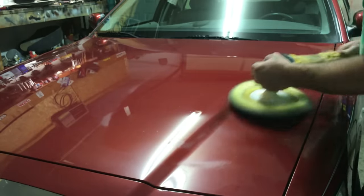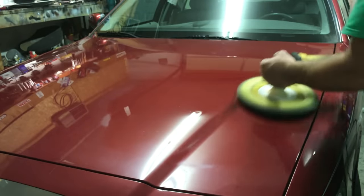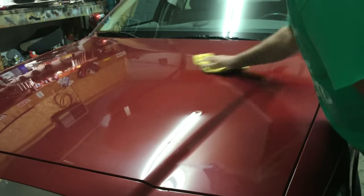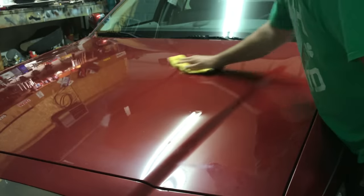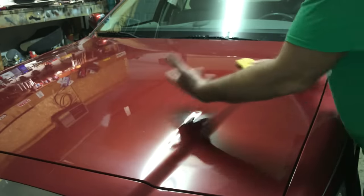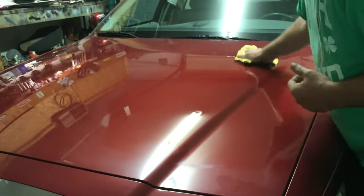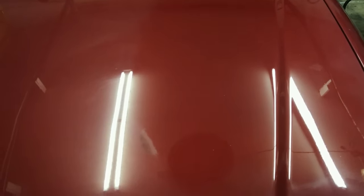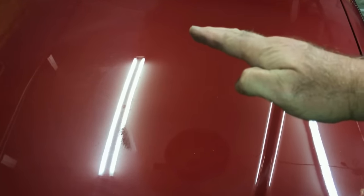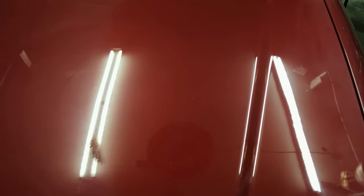Now hold it flat, then take your microfiber — you'll get no scratches, crazing, or anything when you're doing it this way. If it was ceramic coated, after you do this don't use any wax — use a polishing compound and then 99% rubbing alcohol. That's all it is, folks. I don't like doing videos this long but I wanted to show you how to use it: tip the buffer on an angle when it starts to dry up, put a mist of water on it if you have to, and use a super high quality 3M polishing pad. You'll be good to go.